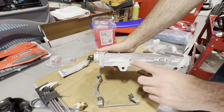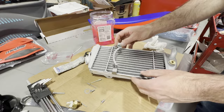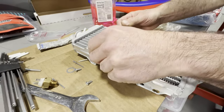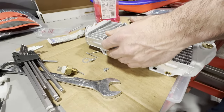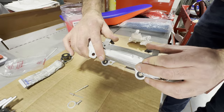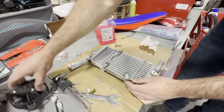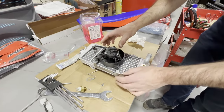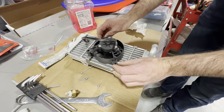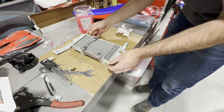You can see in the Beta radiator it's already ready for these to go in — two on that side, two on this side. We're going to have to stretch the bracket a little because it's slightly thin, but if you pull it over it snaps down over nicely. All the holes line up perfectly: one, two, and three. Let's just set it here for a second and confirm the bolts are going to line up — yes, everything is still perfectly fine even after stretching it.